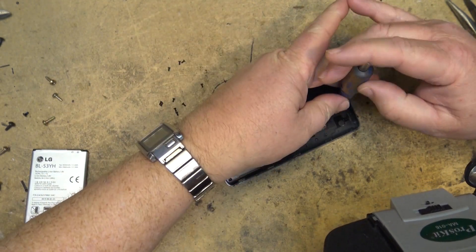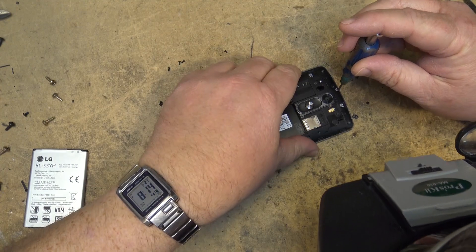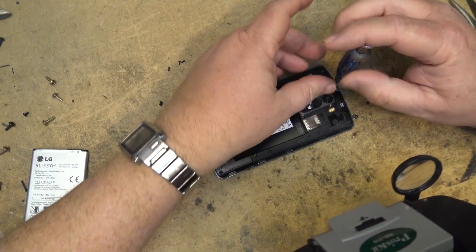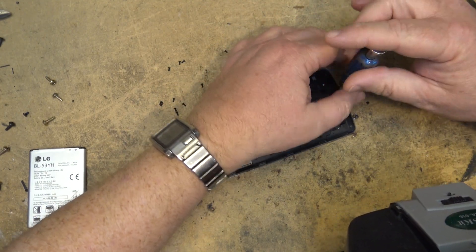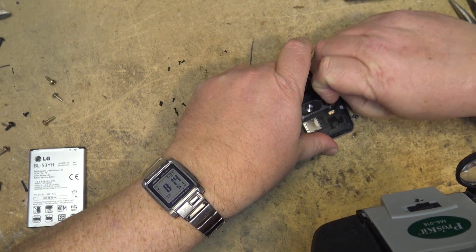What I'm going to do once I get this apart is put my heat gun on, heat the chip up, and try to reflow the solder. I'm then going to put some heat sink compound on the chip, and we're going to do the paper mod — you stick some folded paper on one of the connectors, which presses the connector to put more tension on it.